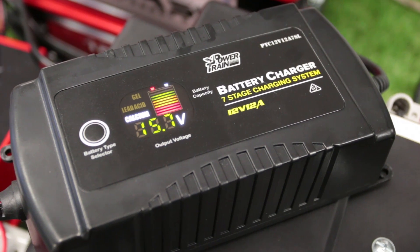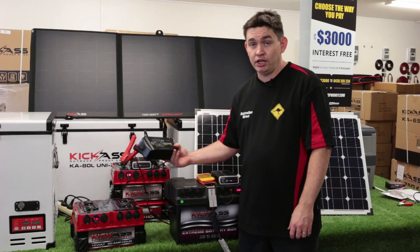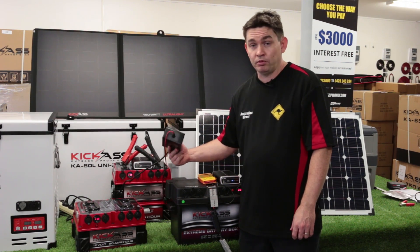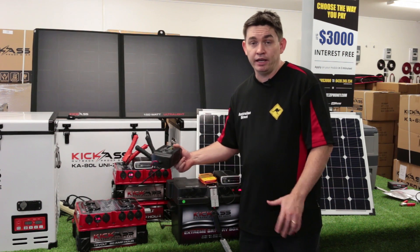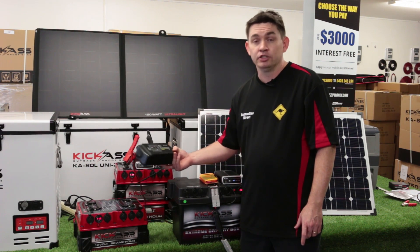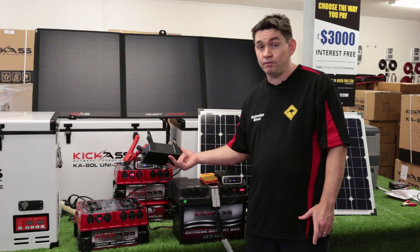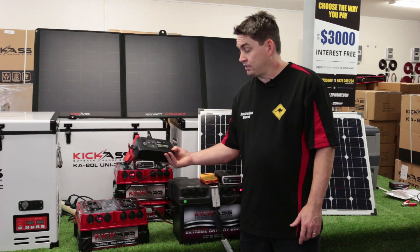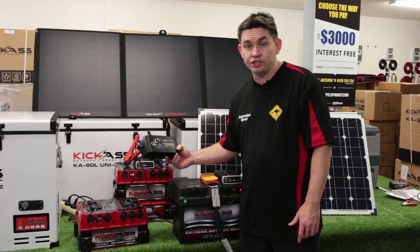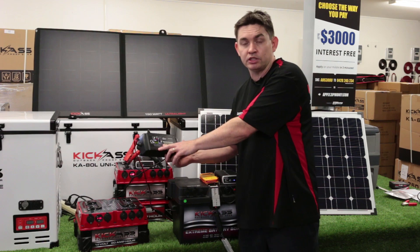The third device is your AC mains-powered battery charger. Usually these are a multi-stage, fully automatic charger that charges AGM batteries perfectly. You need to check that this charger is operating correctly because you might take a generator out in the bush and plug your AC charger into that to charge your batteries. The easiest way to do that is charge your battery overnight — which is always a good idea before you go away anyway. That way you can confirm the mains-powered charger has gone through all its relevant charging stages and entered float mode. The voltage on your charger should be about 13.6 volts at float mode.